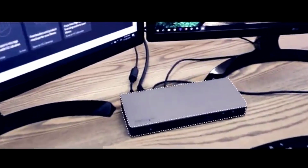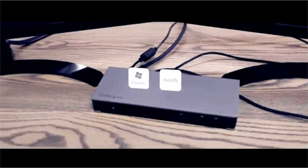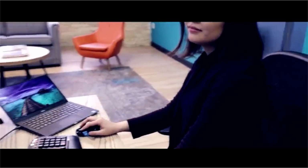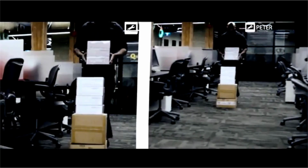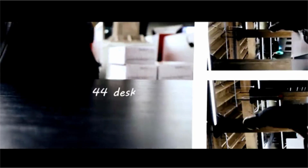Flexible display setup. This docking station supports different display options with dual monitors DP and HDMI, 2048 by 1152p and 1920 by 1080p, single DP, 4K 30 Hz, or single HDMI, up to 2560 by 1440p. USB-A laptop compatibility. This DisplayLink certified laptop docking station works with new or legacy laptops from brands like HP, Dell, Lenovo, Microsoft Surface Pro, and Chromebooks.